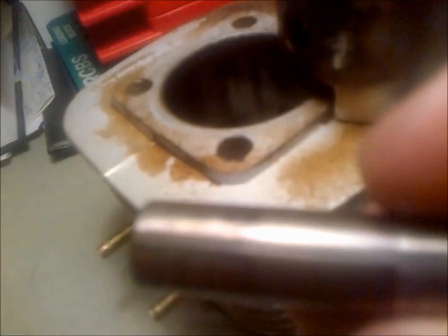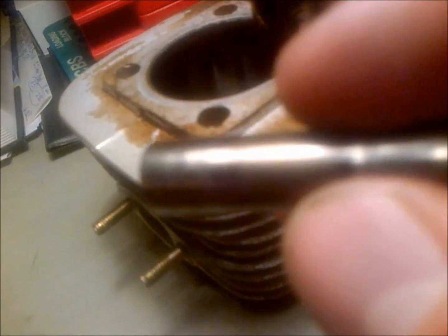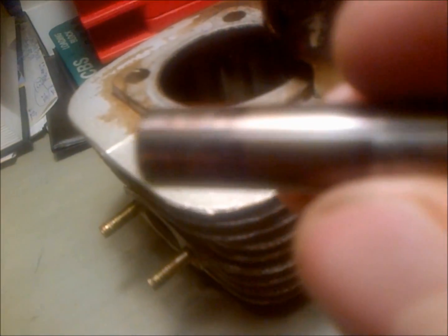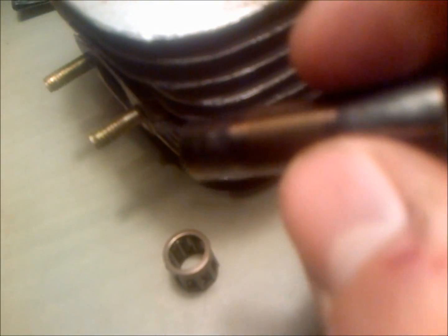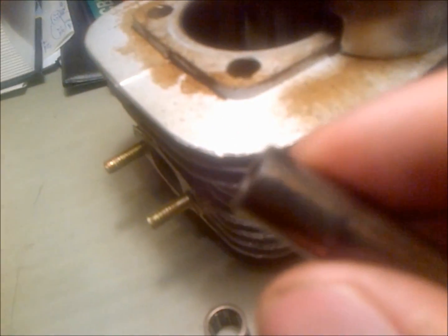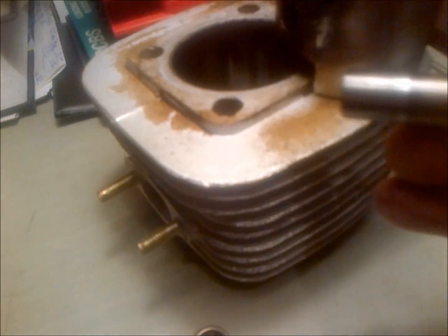So I'd have to say that that's factory error there. You shouldn't have that. And I have another wrist pin upstairs, and it's not like this at all. So you can really feel those with your fingernails, and those rollers, you can definitely hear them chatter when I just roll it over it, and that didn't happen from riding it. That was how it was to start with. So pretty poor quality. So that's something to look into, your wrist pin, if you ever have your jug off.